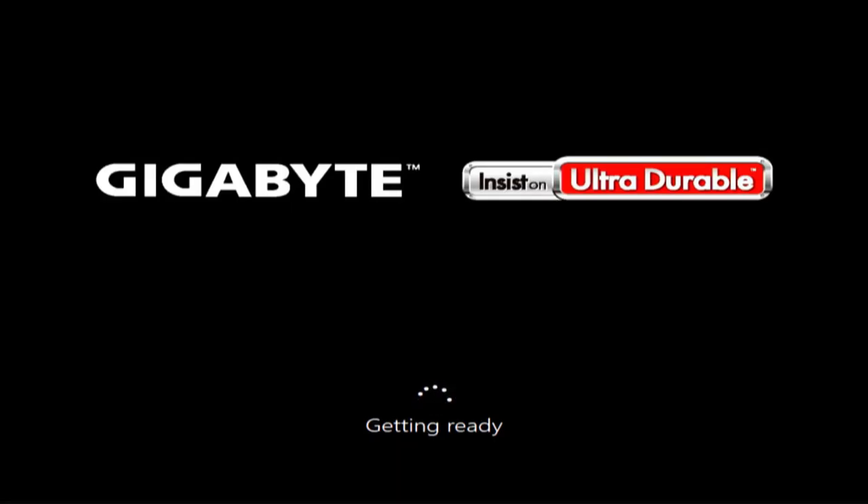So: operating system, then driver CD. Then we have to go online. Microsoft is going to start working, so it's going to be a race against time. We'll go to AMD and download their drivers and some chipset feature sets we wouldn't get from Gigabyte's drivers. Then we'll go to EVGA's website and download their drivers. We might end up going to NVIDIA to pull their drivers down, but I'm hoping we can stop at EVGA. That's evga.com/drivers - we'll put a link up to all this information.